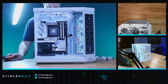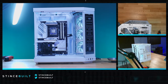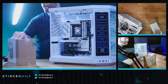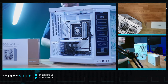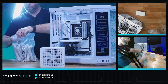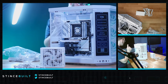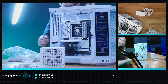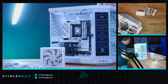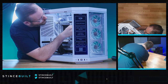Taking off the cellophane covers from the fans. Now the power supply: DeepCool PX850G, 850 watts, ATX 3.0. 850 is plenty for a 4080 Super and 5700 X3D - on an Intel platform we'd go 1000W, but this will be fine peaking around 600 watts. Cables needed: SATA, 12VHPWR, 24-pin main, EPS/CPU. Four SATA connectors should be enough - one for the cooler, one for the hub. All cables connected in the back.